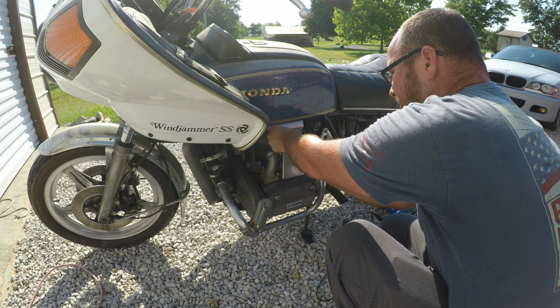This is cylinder two. That looks just as good as the other one. These plugs look very new. I'll be sparing on my PB Blaster. It's about empty. Just enough to lube them cylinder walls up, get them rings wet.